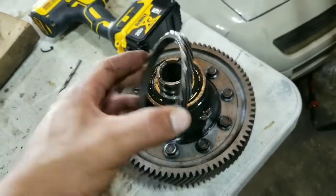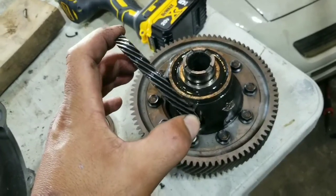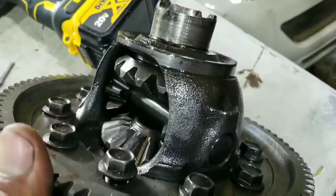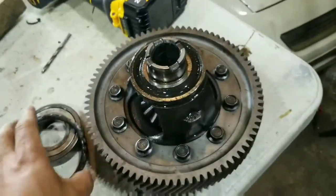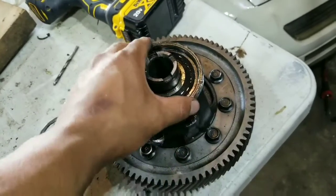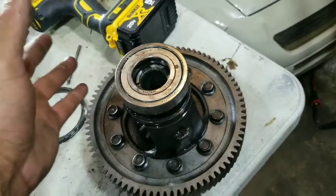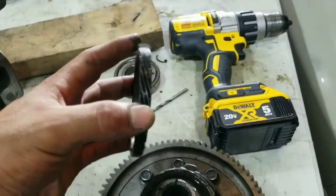But I have this. I'll try to get the part number for you guys and put it in the description. But you can just order this. The differential on this tranny should have this machined end, and you should be able to just press it in. Just tap it in till it's flush with this, then put your bearing back on, and you pretty much throw it back together. Then you actually have signal for your speed sensor gear with that.